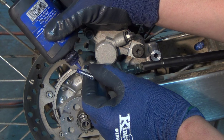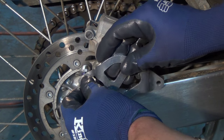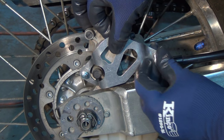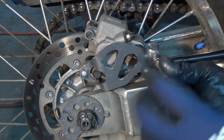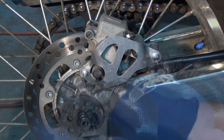The bolts didn't come with lock washers or thread locker pre-installed. I'm a huge believer in medium strength Loctite on pretty much any bolt that I don't want to vibrate loose. And let's face it, on a thumper, everything vibrates. Line up the bracket and run the bolts in. I set up my 8mm socket on a screwdriver so I wouldn't put too much force on it using a ratchet. This hardware is pretty small and you're putting it into aluminum threads, so you don't want to go crazy with the torque.